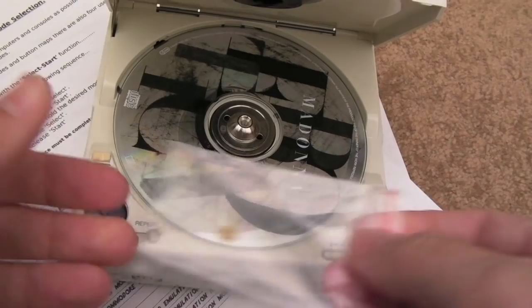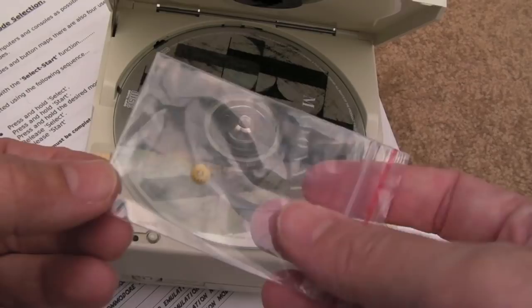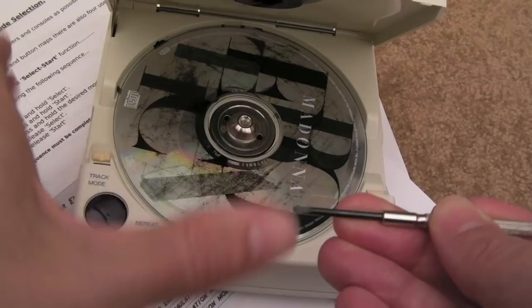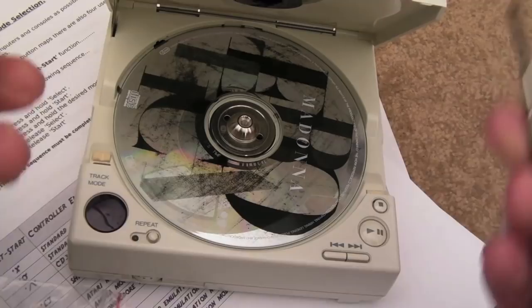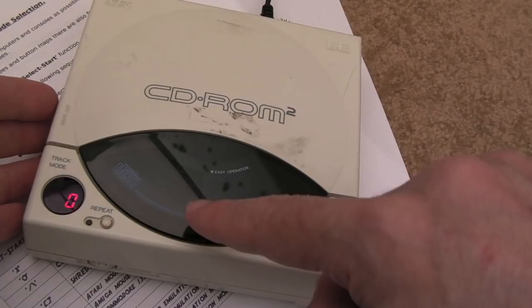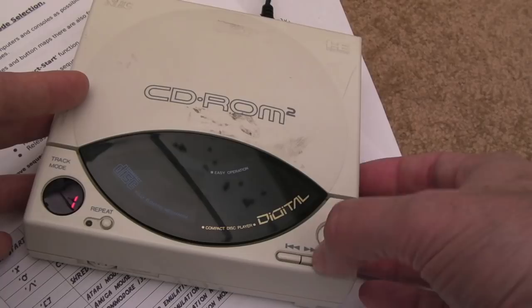Loosely reassembled — haven't got any grease on the gears yet, I'll do that in a sec. The washer on the circlip will cause no end of trouble getting on and off — very difficult. What I did was put it on a flat tool, tilt the unit so the screwdriver stays flat, hold it across the center point and use another screwdriver to push it on carefully. If you're not careful it'll flick off and you'll never see it again. Let's switch it on — look, activity straight away!